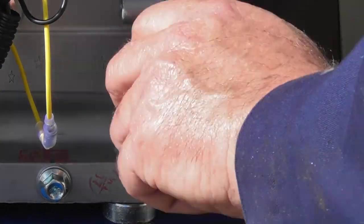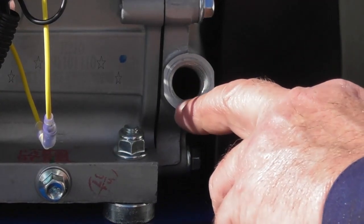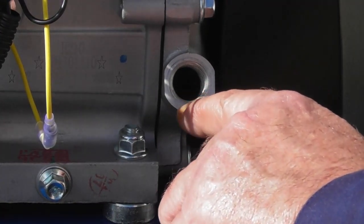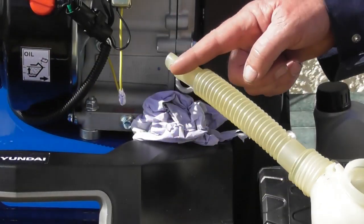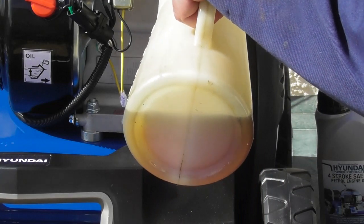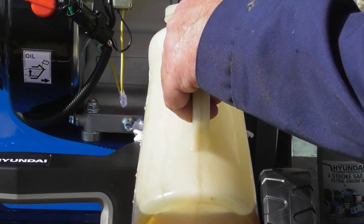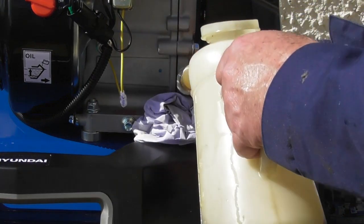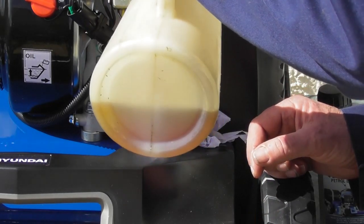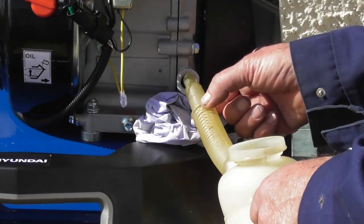To fill the engine oil, we need to remove this plug by turning it anti-clockwise. We need to fill with engine oil until the oil level reaches the weir point of this hole — so we can't get any more in without it overflowing back out again. At the bottom edge of the threads here, we want to come up to that level. I've got some of the engine oil in a suitable jug with a pouring spout, but a funnel and a piece of pipe would do the same job. I'm just going to slowly start filling the engine oil — not rushing it, just giving it time, and checking the oil level periodically. I've got a piece of paper towel here just in case I should spill anything.